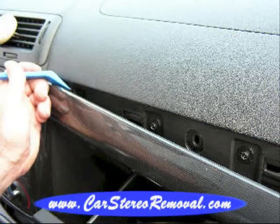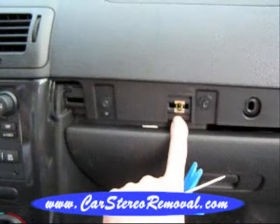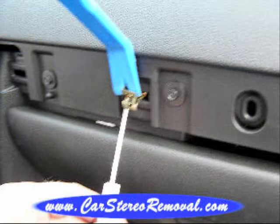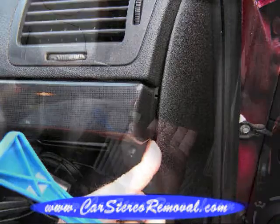The reason for this is this panel overlaps the edge of the panel around the car stereo, and after checking the panel we just removed, there was one clip remaining in the dash, so we removed that and put that back onto the panel. One trick to reinstalling this side panel is when it comes to pushing the end of the dash back into place, pry the end cap slightly away from the edge of the end of the panel. This will allow it to pass and seat properly.